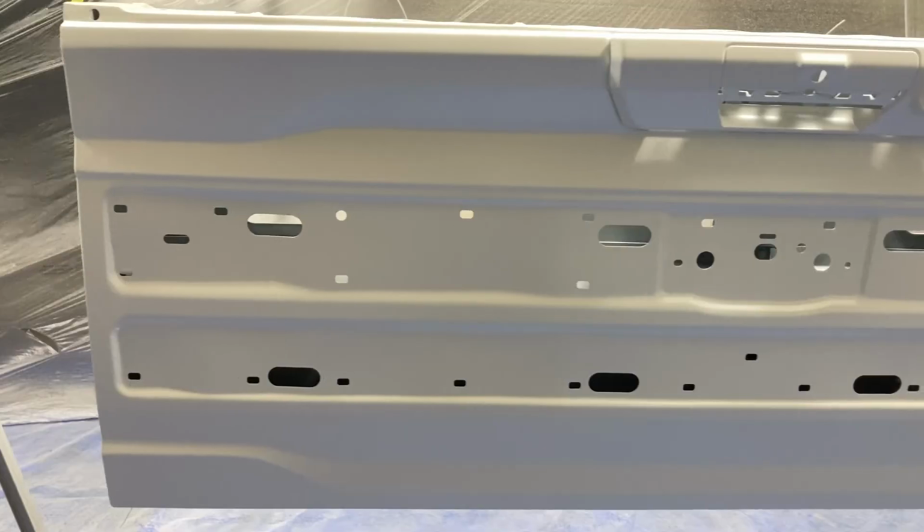So on my spray out, it looked the same way, and what I ended up doing is I put one final last drop coat. I dropped my pressure and just really dusted some metallics on. And that really made it stand up and it matches the vehicle really well. So anyway, that's some tips on doing color matching.